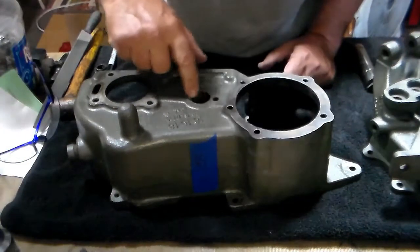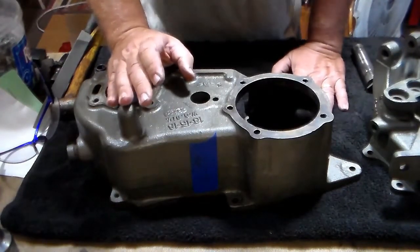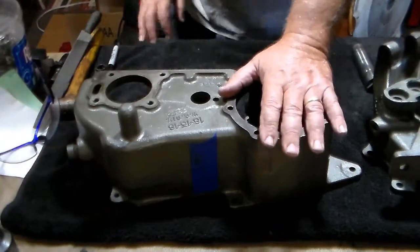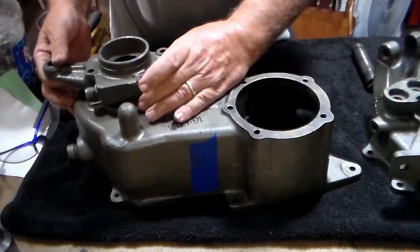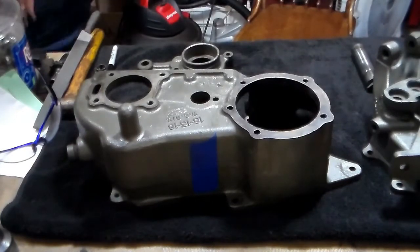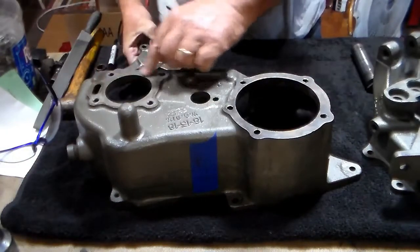That's where your intermediate shaft goes. Make sure that there's no cracks radiating out from here — a lot of times this is the failure point for these transfer cases. They will crack when something gets wedged in the gears, or the gears get so worn and the bearings wear out to the point where the gears bind against each other; it will simply crack the case in half starting right here. At the back, this is where your rear bearing retainer goes. Your rear bearing retainer fits on here, and underneath is where your shimpak is going to go. Bearing retainer goes there. Check all your bolt holes and make sure they're all good.